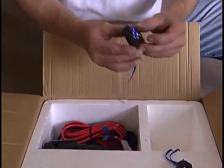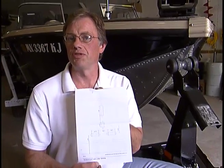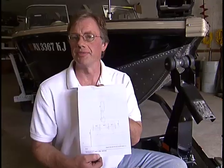With the guidons installed, now you may install the winch. Simply remove the existing winch on your trailer and replace it with the electric winch. The electric winch comes with two wireless remotes to operate the winch, power cord, manual cord, just in case the wireless remotes are lost. Included in instructions is a template for mounting. The template may be used to ensure that your hole pattern is correct to match our electric winch. Simply lay it into location and follow the holes for drilling new holes if required.